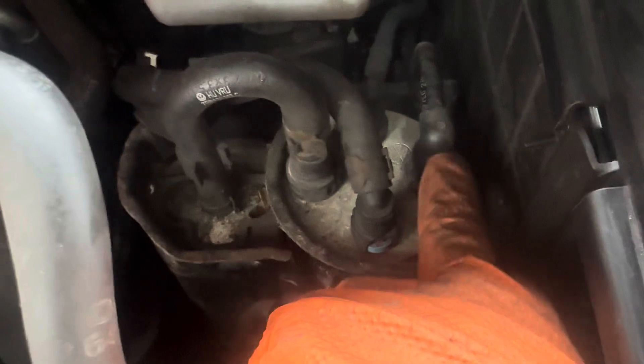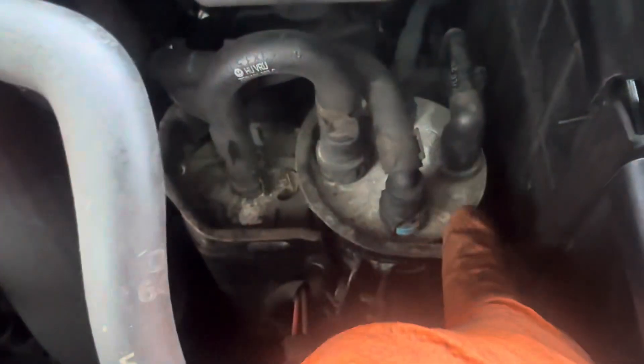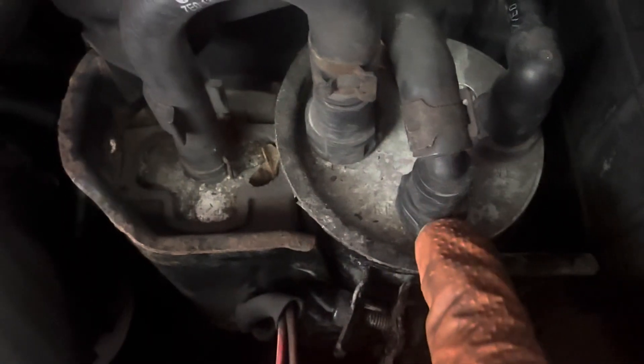Now when you look down here you can see that VF is here — it's a big inlet/outlet — so obviously if you get that right you can't get anything else wrong because you know it's fixed. That's big, that's small, that's small, that's big. The two big ones go there, two small ones go there, and VF goes here. The way you get these off is there's a little blue tab there — you push that in and then you can pull the thing up. Pull the clip off and it gets it out of the way.